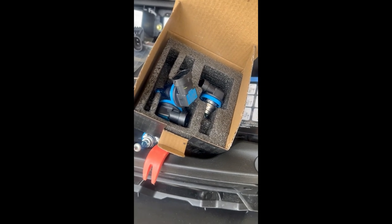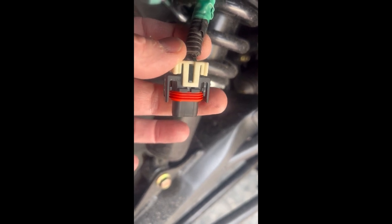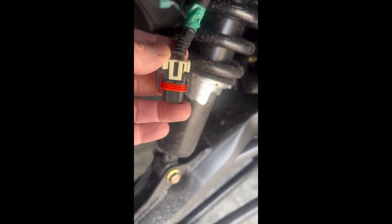I'll add some photos. It's pretty simple — you just reach your hand up behind here, grab the two different plugs, twist to the left counter-clockwise and they'll come right out. Pry the plugs loose, being careful not to break the little black tabs. Spread those out and pull the light bulb down. Thanks for watching.